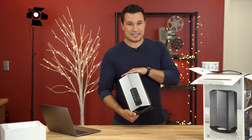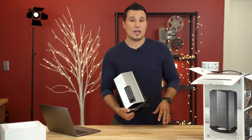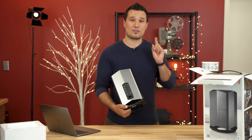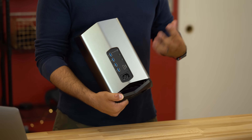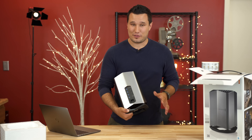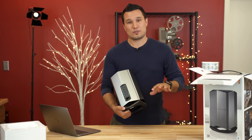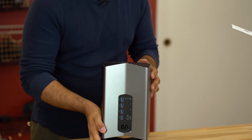What really gets me excited is these two Thunderbolt 3 ports. Most of the time with an external graphics enclosure, you plug it into your MacBook and then you have to plug in an external display, but you're limited to only HDMI or DisplayPort. So if you own a 5K LG UltraFine Thunderbolt display, a 4K one, or a cinema display, you cannot use it. If you spent $1,300 on a beautiful 5K display, you are out of luck — I even considered selling that display. Now you don't have to. This is the first eGPU to support that.